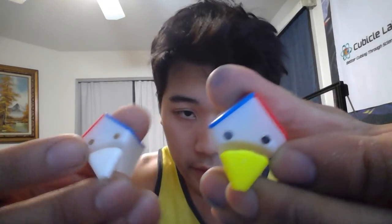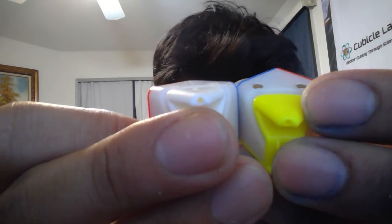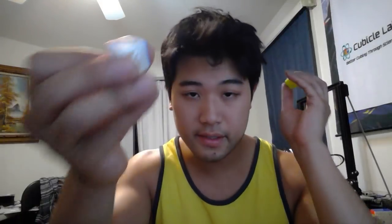The next big difference is the holes are different, the glue is different. These magnets are going to be in there even better. If you can remember my PressFit video, the tools changed around a little bit — the current tool is even better. So this is the old one. You'll see that there's some plastic deformation and the holes are a little rough. This is the new one, and you can see how clean the holes are — they're below the plastic. These are actually super accurate, so the angles are dead on every time. That's another big difference between version 1 and version 2.